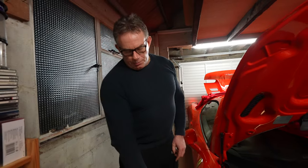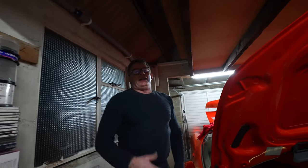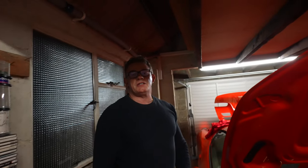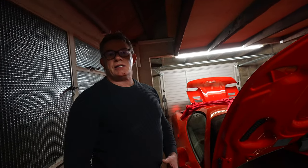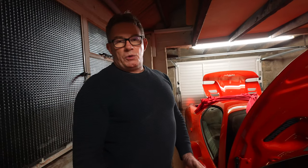It was quite an effort — this car is a lot heavier than the 993 — but we managed to move it back. You can see the imprint the tire tread has left in the carpet; that's the amount of pressure on the tire all the time and why you can get flat spots. I've also over-inflated the tires by an additional 10 psi above standard, putting them up to around 40 psi — some people go to 45.